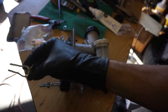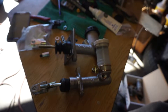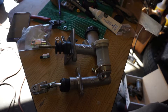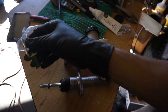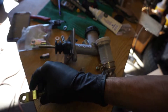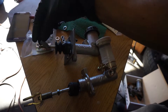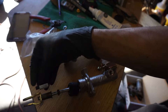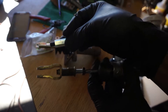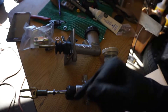You can also buy a new clevis nut to adjust for the different thread type on the Wilwood if you don't want to change that. The reason why you're probably gonna need a little extension is because the thickness of the adapter plate is a quarter of an inch, so you're pushing this engagement point back — meaning the actual clutch pedal is sitting a quarter of an inch further in. Any kind of nut coupling you do, whether on the OEM one or on the new thread, will help compensate that little difference. On other cars they don't really need this, but in my case I think we're going to need it.